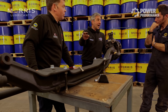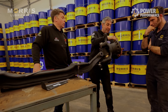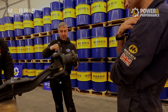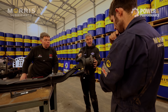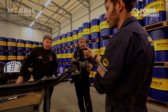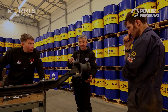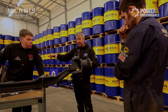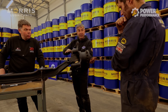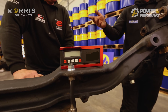Because it's moving everywhere — look how it escalates massively. It's difficult to measure everything. So the next time, when Dave came back up last week for round two — because time's running out, we're bolting this in next week, testing next Thursday — we made a sacrificial set of hubs with just steel bushes in the top. It didn't matter about the heat and kingpins. We twisted it with it built up like this, so it's easy to measure all the time. We could keep measuring it bang off the machine bed with a big set of squares. The axle's bang onto the bed, everything's level. So it is actually perfect now.